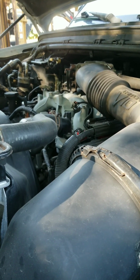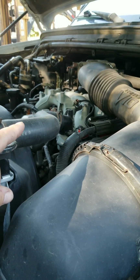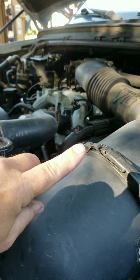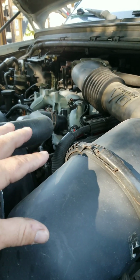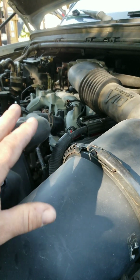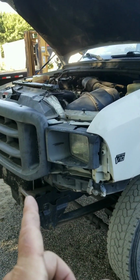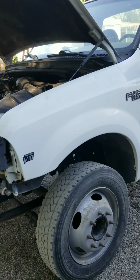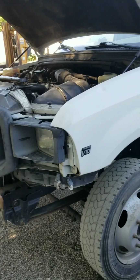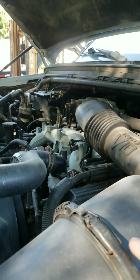So, figuring out some issues. One issue is that the alternator was charging at idle, and then you step on it and the voltage just starts dropping. I thought it was a draw. It's going down to like 10 volts as you stomp on it, but it's still charging the battery because the majority of the time you're above 12, 13, 14 volts as you drive it. So, no power.